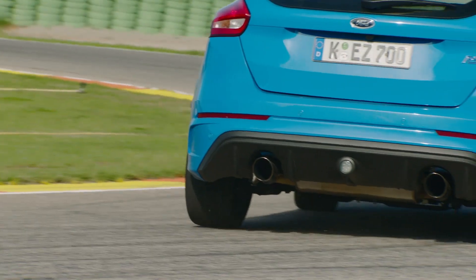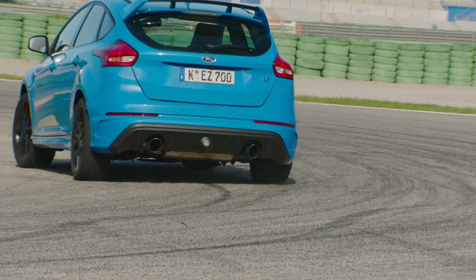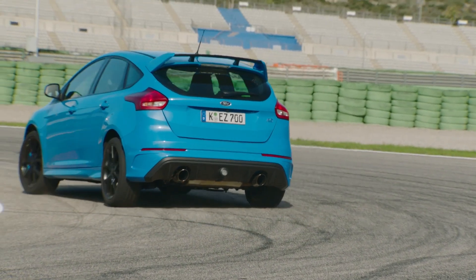What we've done is we've got an offset gear ratio front to rear. That way when the all-wheel drive system engages, it tries to over-speed the rear wheels. It gives you traction for traction events, but really gives you a handling feel when you're driving aggressively - going into hot corners and coming out. That torque vectoring is what enables what we call the drift mode, and some of the other various performance features and feel you can get in this vehicle.